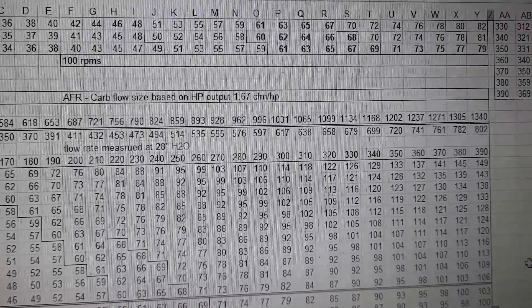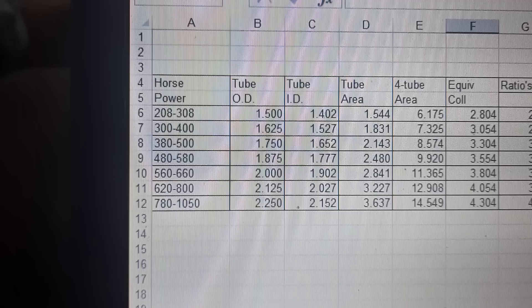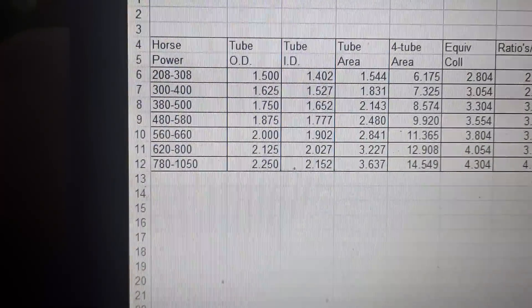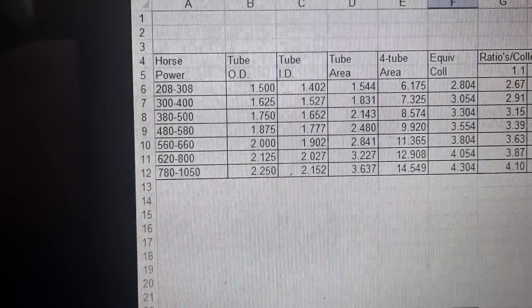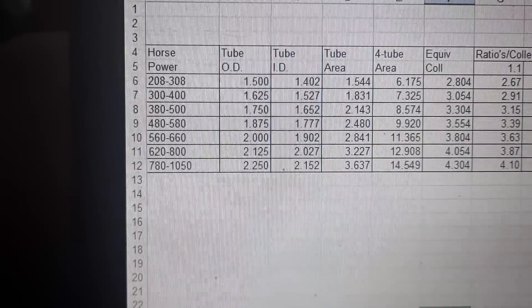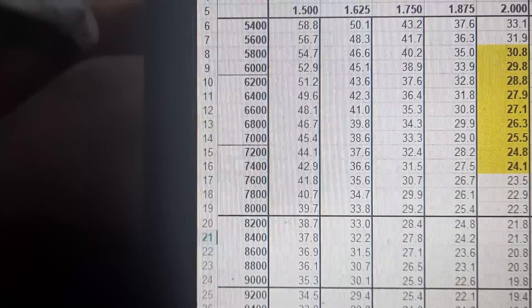Direct and injected engines do make a little bit more horsepower. When I look at the horsepower levels and cylinder head flow, and look at the primary tube diameter, I find that at 680 to 690 horsepower, we would be on the high side of 2 inch, low side of 2-1/4 or 2-1/8 inch. On a smaller engine you want to go to a smaller tube, a bigger engine a bigger tube. So sizing for this 680 horsepower engine, we arrive at 2 inch primary diameter.